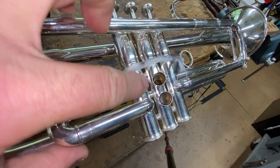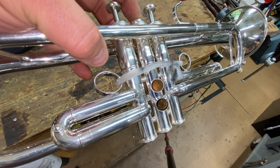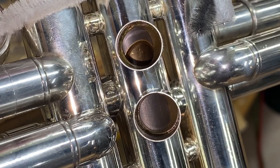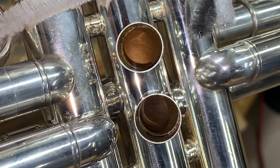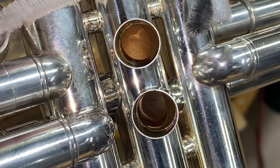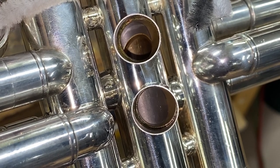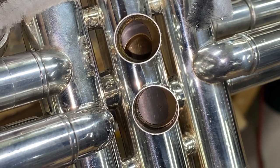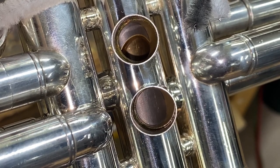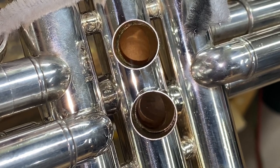We've talked about this before — the second valve and being able to easily see. We talk about our alignments here. Let's zoom in: on the downstroke you want your spacer to stop at this position. But we've got severe side-to-side movement as well as a clacking. What happens is, number one, it makes a bunch of noise, and number two, you see you're getting all this play.